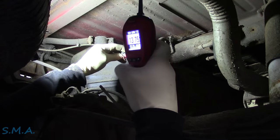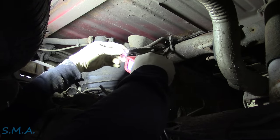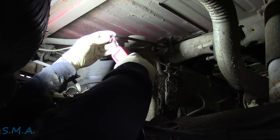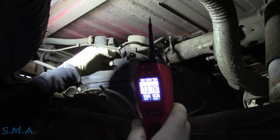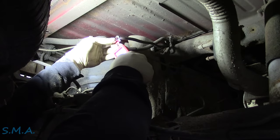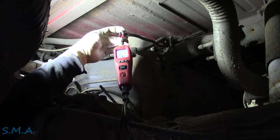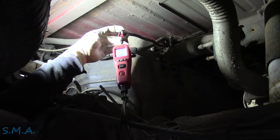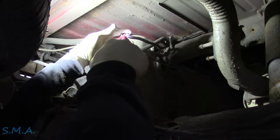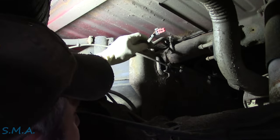We'll hit enter. It's going to put a small load on this wire. Right now at the tip we have 13.76 volts because we have our maintainer on it. So we're going to put that on the control wire, and then I'm going to use the scan tool and turn it on. Turn it back off. So that tells us that our circuit is intact. Now if you don't have a Power Probe, you could just use a quarter amp test light.